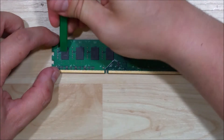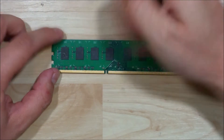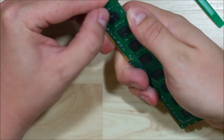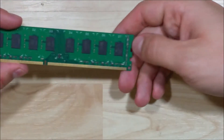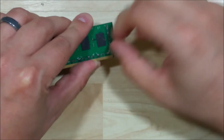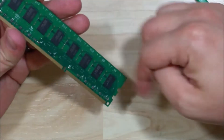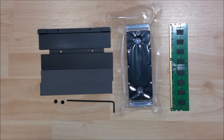I just like to take a nylon spudger and just pull it back — try to get it all nice and cleaned up. The reason why you want to do this is you don't want this pulling the chip away from the new thermal tape we're going to put on top of this. So you want to make sure you get it nice and clean, with no residual glue or adhesive left on top of these chips. You need to make sure you do it on all of the chips. I'm going to go ahead and jump forward and talk about putting it into the heat sink that comes with the RAM block.